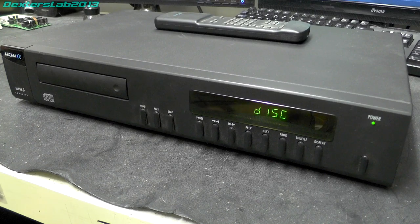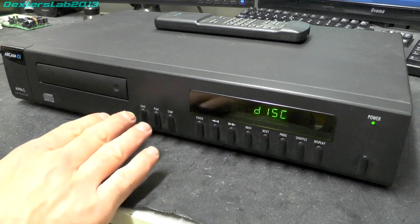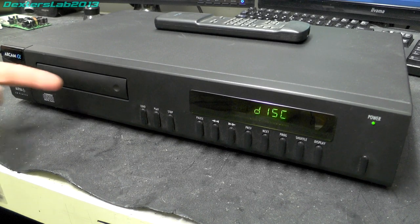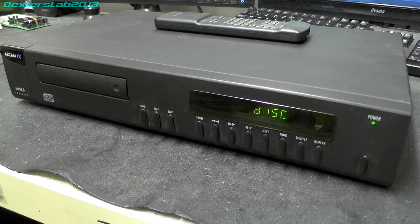So the first thing I did was power it on and try to test it. I powered it on, pressed the eject button and it didn't eject — it made loads of grunching noises. Now I have actually already opened it up and I know what the problem is. It's quite a common fault on these. There is a drive gear which ejects the CD mechanism out so you can put a CD in, and the plastic just goes brittle and breaks, and that is exactly what's happened here. So I'm going to take the lid off, show you what the problem is, and detail through how to fix it.